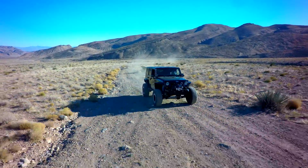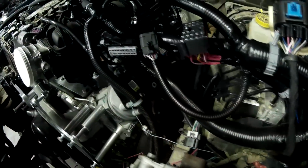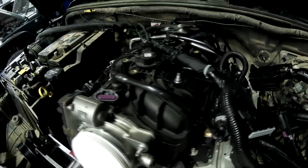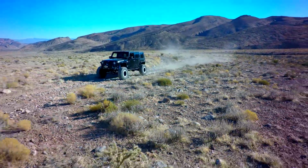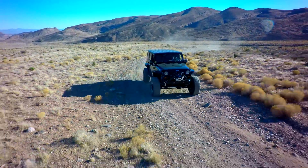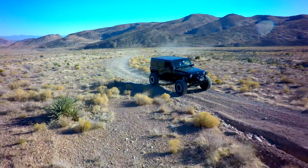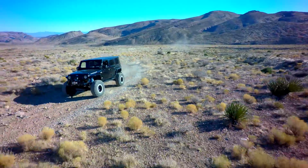Now here's the critical part of the electronics in our new Easy Kit: factory harnesses. The engine harness is the most critical component in your swap. If the engine computer were the brain, the engine harness is the circulatory and nervous system of your swap. It's the most critical part that makes the swap not only reliable but functional. Manufacturers have spent untold amounts of money over the years to develop the proper engine harness. We're talking power distribution, ground distribution, emissions compliance, failure modes.